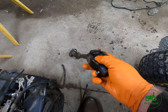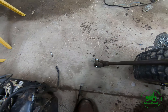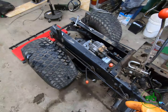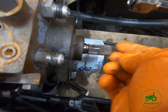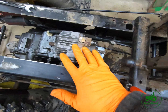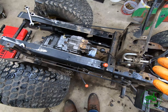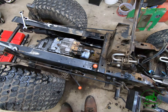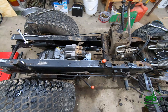We'll get in there and you can see some of the play or wear in the drive shaft itself. We'll get the u-joint replaced — that's the plan. We'll also go ahead and look at this: the wobble on the shaft wobbled long enough that there is some wear on this shaft right here. What we're going to do is just take this pump apart, because the pump is fine but the shaft is worn out. We'll explore the innards of the pump itself and go from there. In the next part of the video I'm going to look through some Onan parts specs.